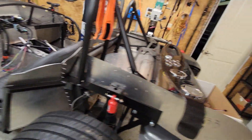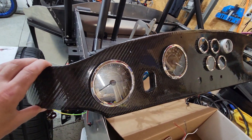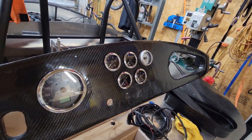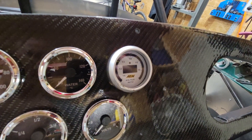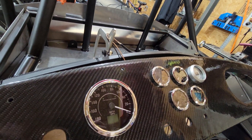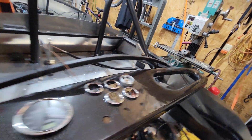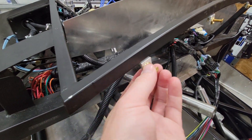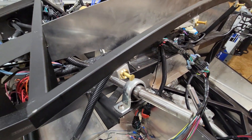Since we're talking about gauges, here's my dash. I skinned it with carbon fiber because there was some damage on it around the glove box area — I like how it turned out. By the way, this is not the gauge that's going to stay there; that's my wideband, so when I'm driving I can tune it and get good AFR readings. You can see I've got some holes poked in the top — they'll be easily removable because I put aluminum angle pieces with a rev nut on the inside. This is just a 10-32 brass screw. Five of them total.